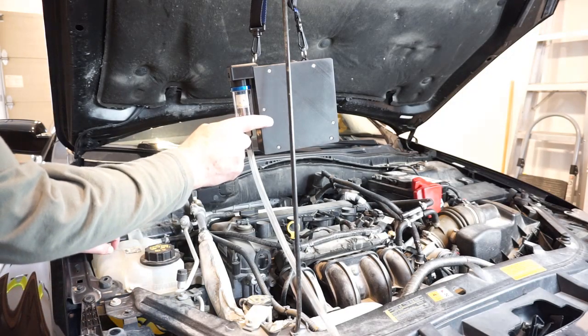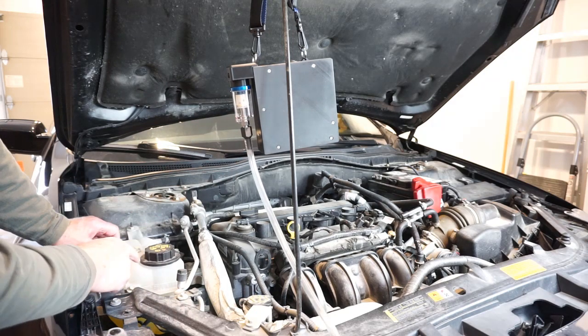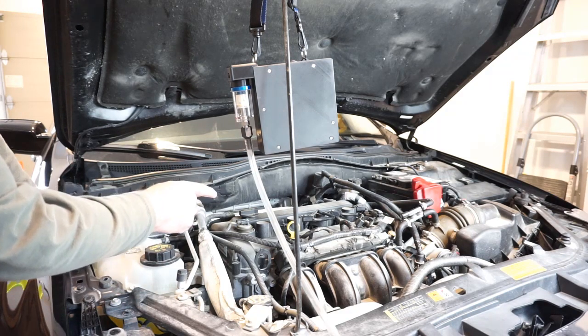For full disclosure, this is not a high-end unit — we have to make some allowance. It's not perfect, but it's pretty damn good. And the ability to detect CO2 leads us to be able to do this: from the get-go, the hope was to have this HS101 BLT gas be able to detect combustion byproducts that would have found their way into the coolant from a defective head gasket.